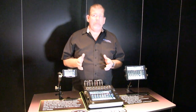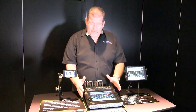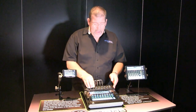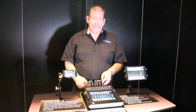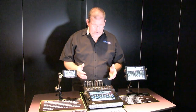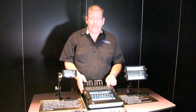This is the latest in their version of iPad mixers. As you can see, it comes with essentially a box with gain controls or trim controls here and no other controls. You have eight balanced line mic inputs, four auxiliaries that you can run monitors with or for other purposes, two left and right outputs, and a headphone output.